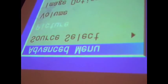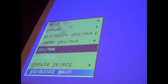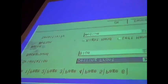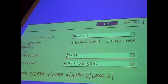Now I'm going to focus the image, because it's not focused yet. You'll notice that everything's in reverse because it's hitting a mirror. One thing that LCD projectors allow you to do, though, is to switch that in their settings, because they're designed to project front or rear. So you go into the settings — it's a little bit hard when you're doing it backwards, but I can do it — and you go to ceiling rear projection, click OK. There you go, now everything's in the right orientation so you can read it.